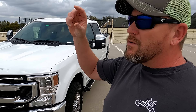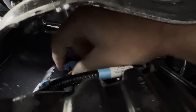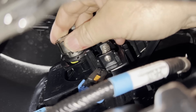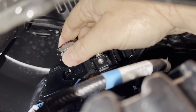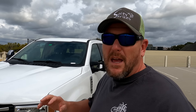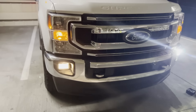There's a little clip that you just have to pull back, then you pull down to the wire and disconnect it. Once you've got that done, all you have to do is twist counterclockwise and pull out, and the light comes out. Then you put the new one in, rotate it clockwise, plug it back in. That's it. And these things make such a huge difference. Take a look here and you can see the difference between the LED and the regular lights.